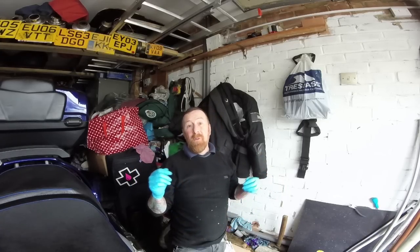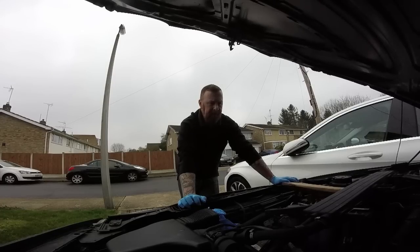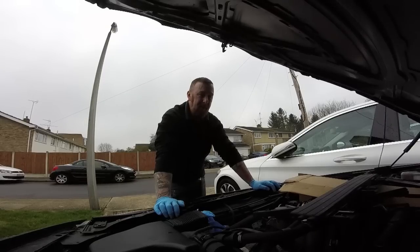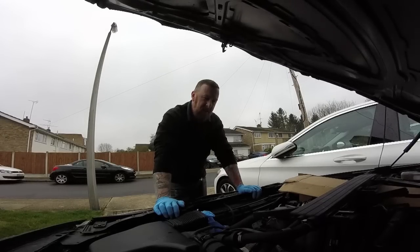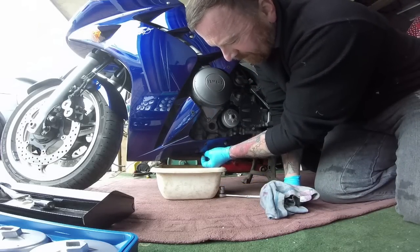I'm going to continue the oil change, but also doing more stuff. BMW 1 Series - this is not where I normally am, it's not a motorbike. The BMW 116 with the N40 engine - what goes wrong on these engines? Cam chain. This doesn't go but all these go - that's snapped, and down here the tensioner has gone. I'm a little bit out of my comfort zone. I'm thinking I might tap the top off, jack it up, check the sump, all the bits and bobs off the bottom. Sometimes you have to get someone in to help you - that's what I may end up doing here. It's just a big job.